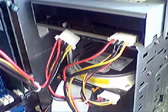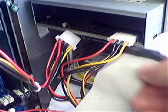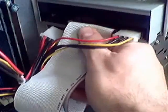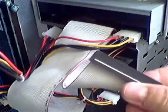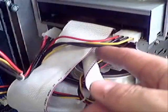We also need to position it correctly into the CD-ROM. If we take the cable that we're going to install the CD-ROM to — which is obviously connected to the hard drive — we can see that midway down this cable we've got another connector, which is what we're going to attach the CD-ROM to. So we're going to install the CD-ROM cable into the CD-ROM now, and the IDE cable just slides in there and that's nicely seated. At the bottom of the cable, this piece here, this is the bit that's going to go into the motherboard. Following that cable from the hard drive, we can see it comes from the hard drive to the middle connector, which goes into the actual CD-ROM drive.